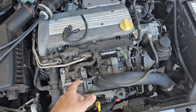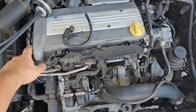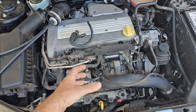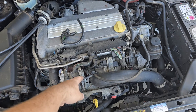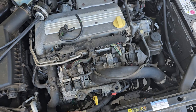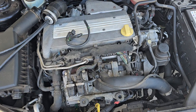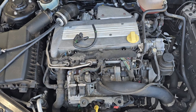What essentially the bypass circuit is — we have our bypass valve here, and this goes down onto the turbo. What the bypass valve does is, when the turbo makes too much boost, this valve kicks in and basically wastes a lot of the boost. It's like the blow-off valve, essentially. We have the waste gate up there as well, so it's like a way to limit the boost.